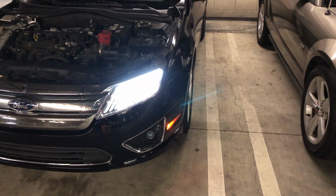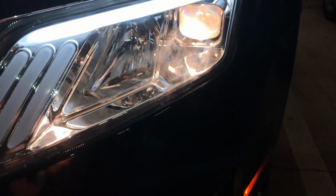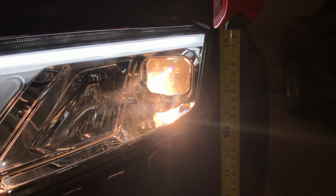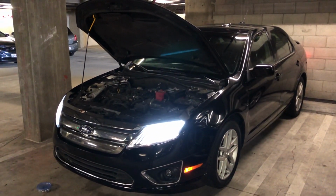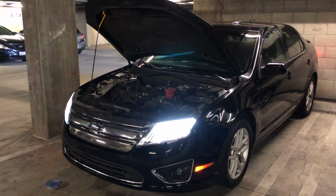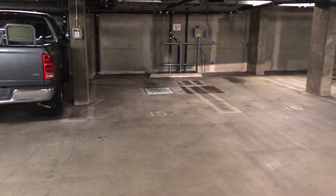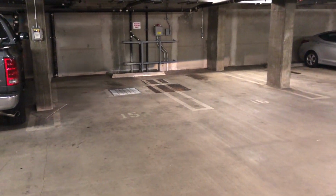So what you'll need to do is take a tape measure, come over here to the low beam. Now you'll need to be on a level surface. Measure from the ground all the way up to the center of the low beam bulb, 26.5. So the 26.5 inch measurement will become the horizontal reference height. And that translates into a horizontal reference line, which is how tall it'll be on that wall. That is where the highest intensity output will be from these headlamps.